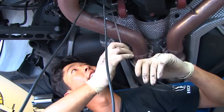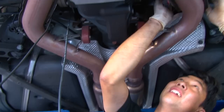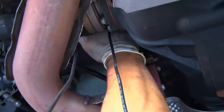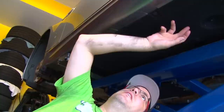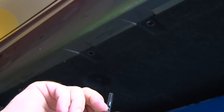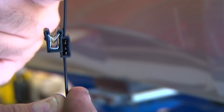Now we're doing the passenger side rear shock. We route the wire above the differential so we don't tear it up, running it along the brake line as a perfect guide — zip tying the wire against the brake line keeps it away from the axle. There's also a plastic and felt undertray — probably for noise reduction — which has to be removed because the wiring runs from front to back under there. If you're doing this at home on jack stands, set aside a whole weekend.